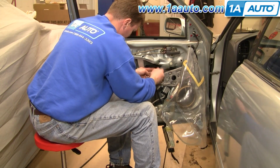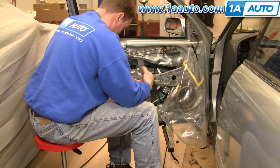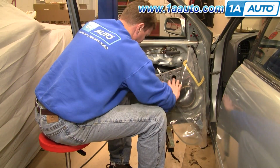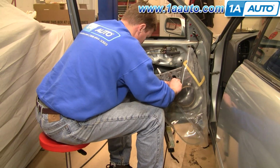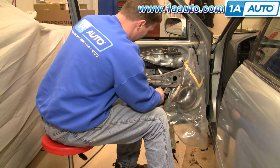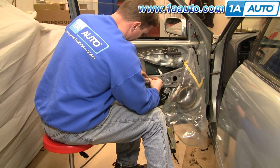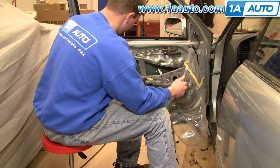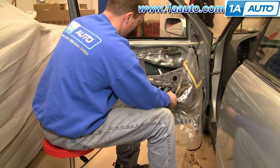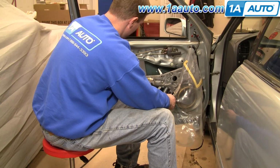So there's 8 bolts in all that you need to tighten, and they need to be firm. They don't have to be super tight or anything like that, just nice and firm. Now that everything's tightened up, just want to route your harness right through here, clip it together. My switch must have been down. So keys on. Let's see. Everything's working correctly.